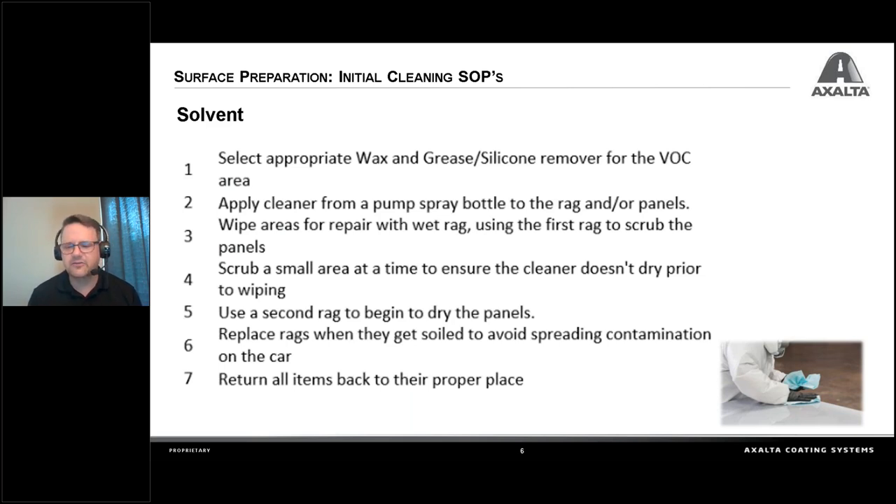Always remember — I'm in Canada, so we have a rule with the government that I can only use a solvent-based cleaner prior to sanding. Once I put a sand scratch on the car, it actually has to be a water-based cleaner to the end of the repair. There is a stipulation where if we use an aerosol-based solvent cleaner, that's allowable because there's only four ounces of product in those aerosols. But always check the regulations in whatever area you're in to make sure you're within code. We always recommend a pump and spray bottle — the days of a technician dumping a bunch of product on a rag, about 80% of it ends up on the ground. It's wasteful and you're emitting VOCs.